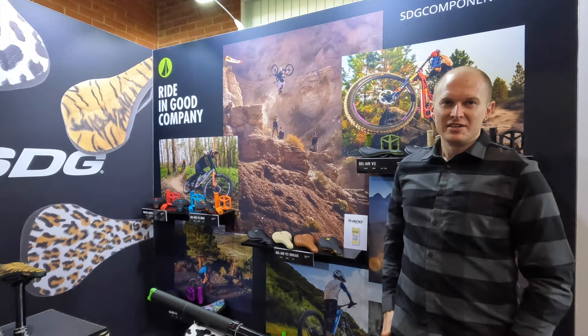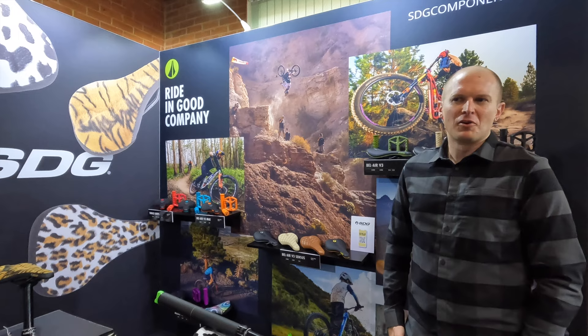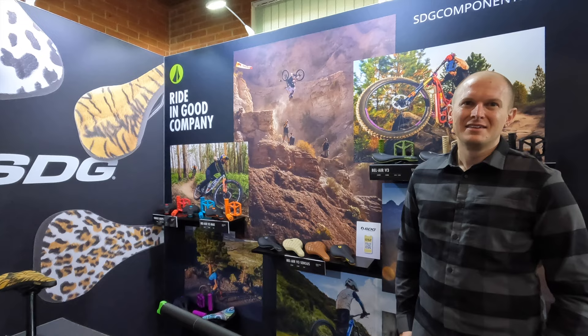The 55mm is a 75 stroke down to 55. It's a good option for junior riders because we have such a soft compression rate — we've tested it down to a 70-pound rider and they can still drop it no problem. For all the junior shredders out there, you have a super compact option. Or even just parents looking at kids bikes — having a post you can adjust over that range is going to make those bikes last longer as well.